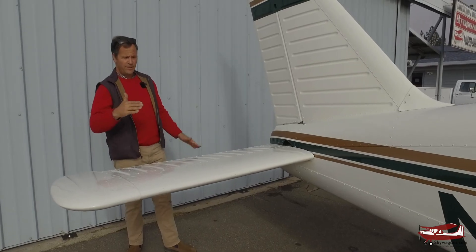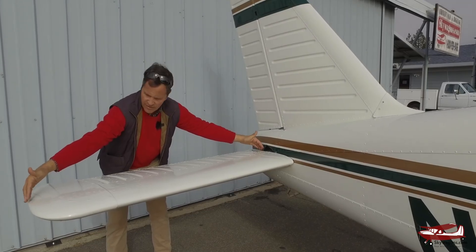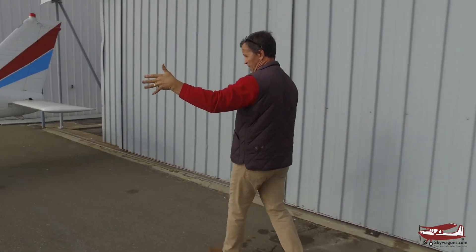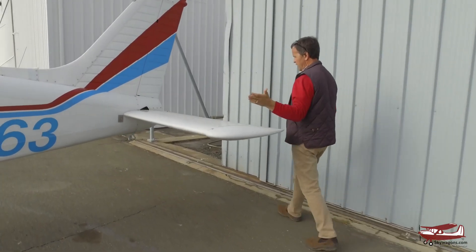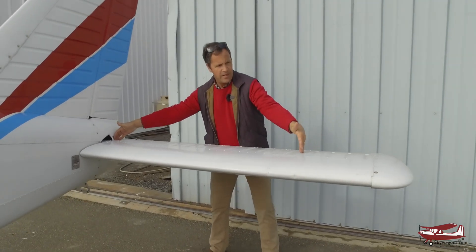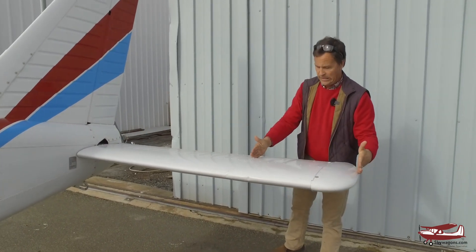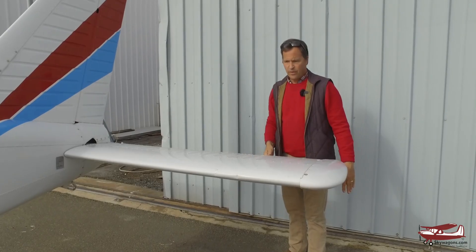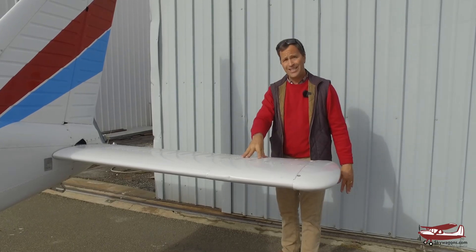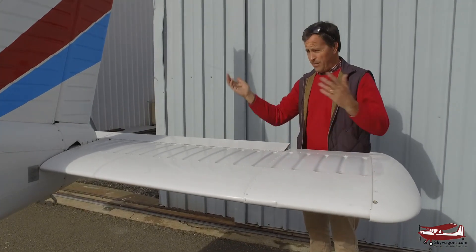Square-winged Hershey bar planes have a relatively narrow tail — I can easily reach both sides of it. Once you get to the tapered-wing planes — which would be a Dakota, a Warrior, and an Archer — they're much wider. You can see this rivet line where the old tail ended with its cap, and now this wider tail: I can barely reach both ends of it. It's much wider, so there's much more authority — roughly 18 inches times two, three feet. So all Warriors, all Dakotas, all Archers have the wider tail — and Senecas, strangely — with indents. There's no such thing as an out-dented wide tail because that would be pre-65 and they didn't make Warriors then.